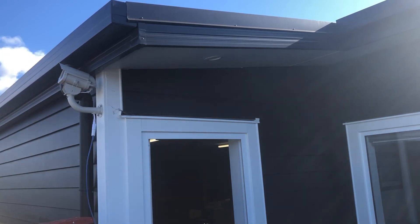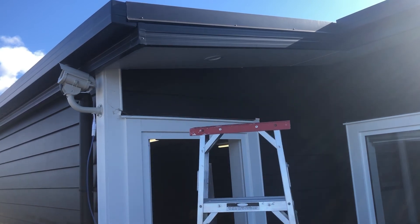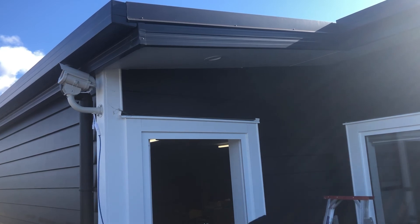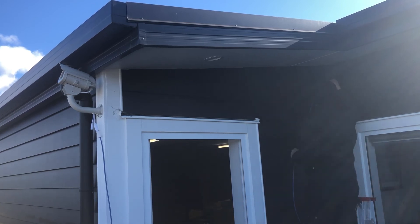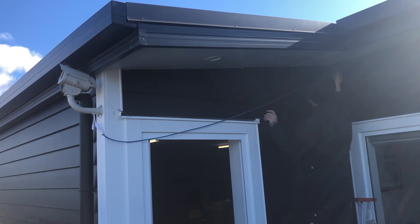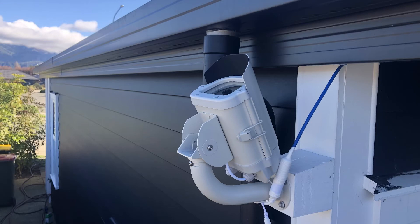Some of the power over ethernet cables have a second level connector for 12 volts, which might be used for a fan or heater inside the camera — you should wrap the end of that in self-amalgamating tape as well. I poked the network cable up into the soffit and was able to fish it out from the inside later. That's the angle that I have the camera pointing up into the sky. Note the block that offsets it from the side to get the angle up so that I don't end up looking into the gutter.